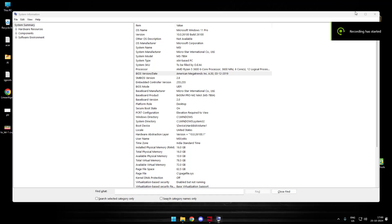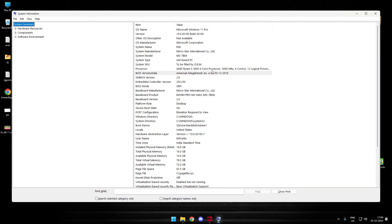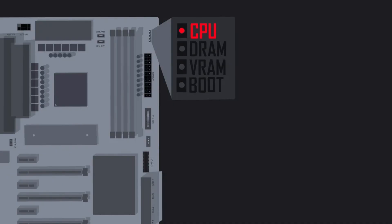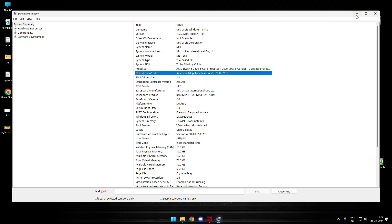What's up guys, it's Technogel back here and today in this video we'll see how to update the BIOS specifically for MSI motherboards. I am running a Ryzen 5 3600 on my MSI B450M Pro M2 Max and the BIOS is pretty much old, from 2019. It's a test bench. I was running a Ryzen 5 3600 and today I need to test a Ryzen 5th generation. I plugged it in and I see that the CPU error LED is beeping constantly, which clearly means that the processor is not being read by the motherboard, and then I realized the BIOS needs to be updated before that. So let's quickly see how it can be done.